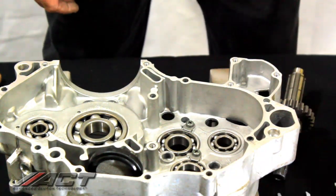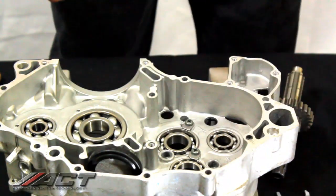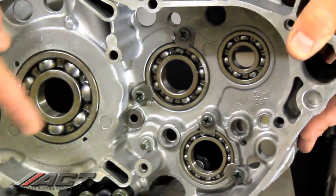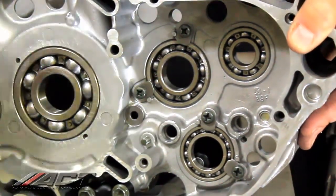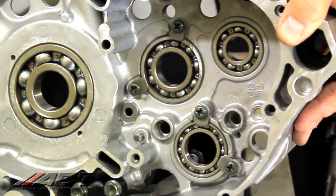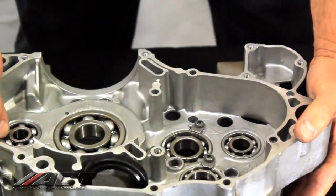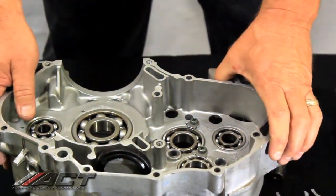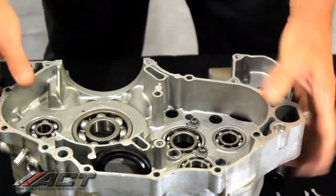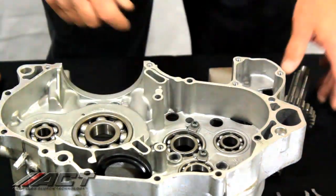And the third would be the second shift fork that has to go around the larger fifth gear. You can see here that this case has already been clearanced. This area around the shift fork boss right here has a minor interference with fifth gear. You only have to go about a sixteenth of an inch deep and it shouldn't cause any significant problems. You can cut it with a Dremel tool or a die grinder or anything pretty much, and you want to go about a sixteenth of an inch thick on this web.